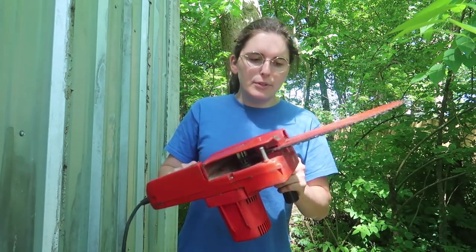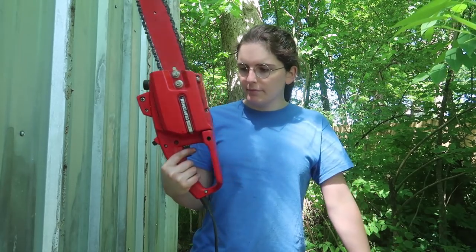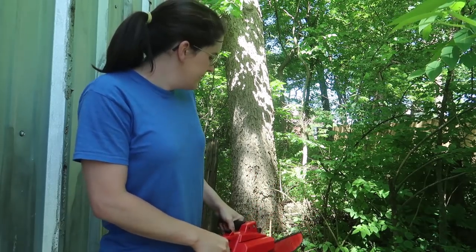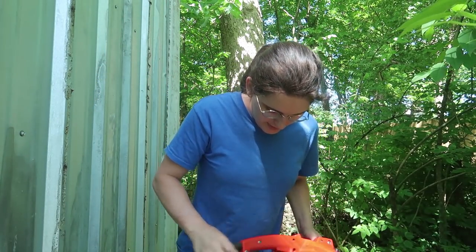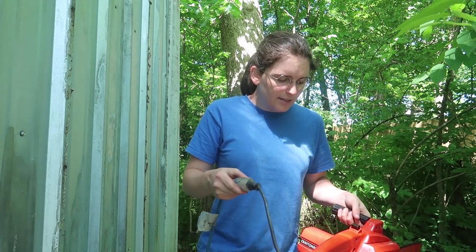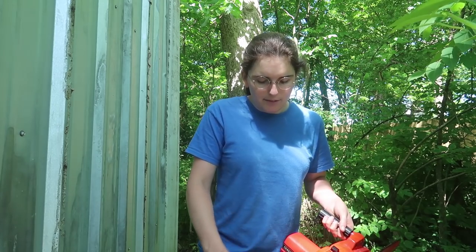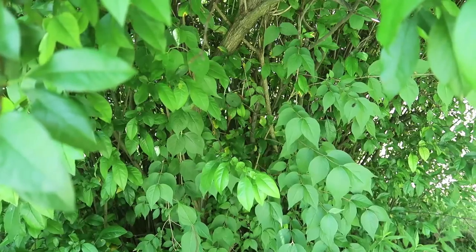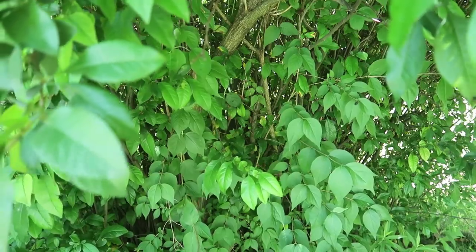This is a nice little free tool that can possibly be better, but it'll be nice for little things like that. And it's actually pretty light, so it won't be hard to carry around. Thankfully, this is a universal motor, so I think it could run off of DC pretty well. I just need to fix the switch, because the switch is expecting AC, and it wouldn't handle switching DC very well. Alright, I'm running through like 5 extension cords to get out here, but oh well.